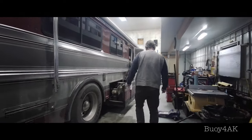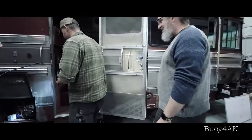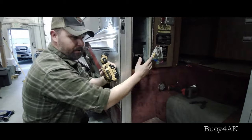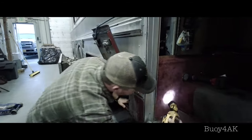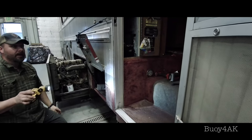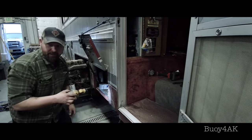Morning! Good afternoon, I guess. We've got presents! So here's kind of what we're dealing with right now. We'll install this inverter — I think we'll be able to stand it into the bus somewhere. What I want to do is actually do two circular bends, because we can put them on the screw right here too — it's kind of an open spot. We can just run the duct. Actually, that would be easier and better. We can just do a six-inch round duct in between, and a six-inch round vent cover there.